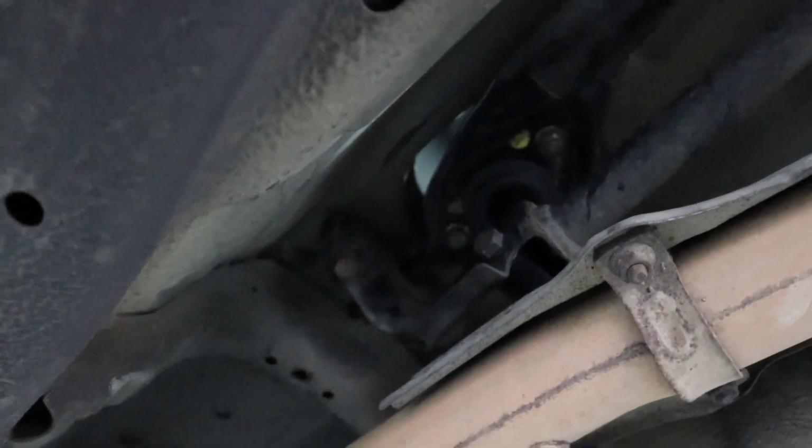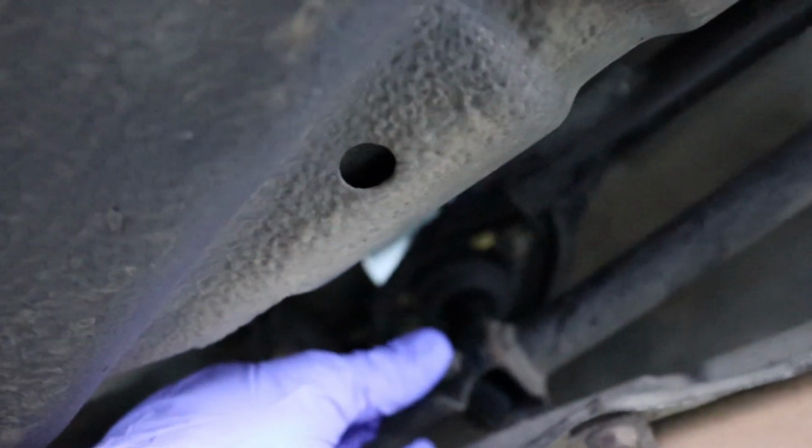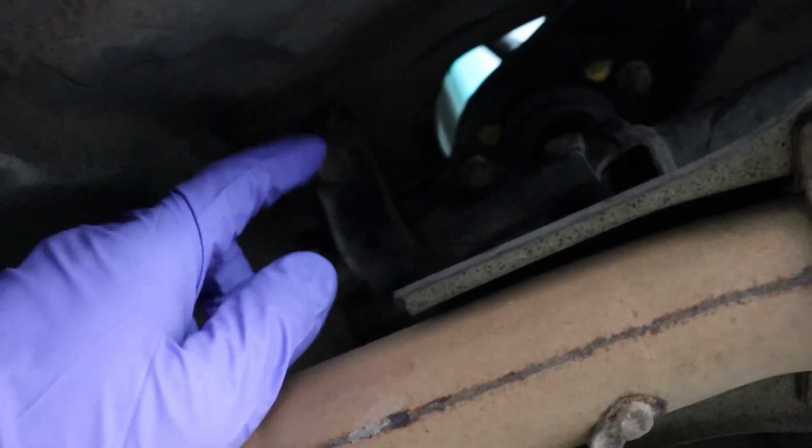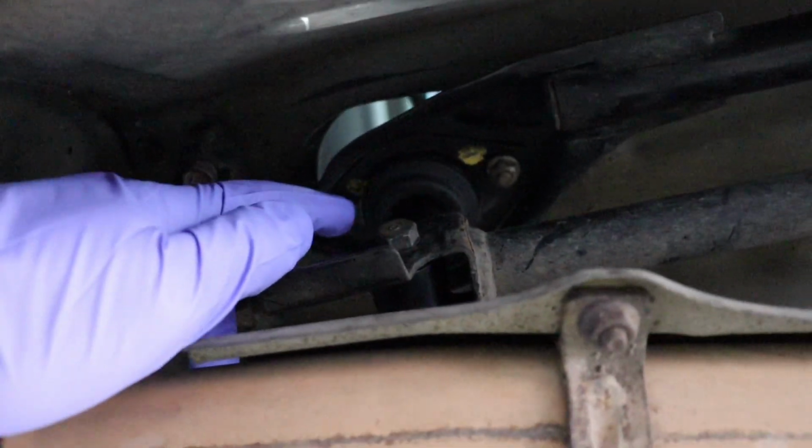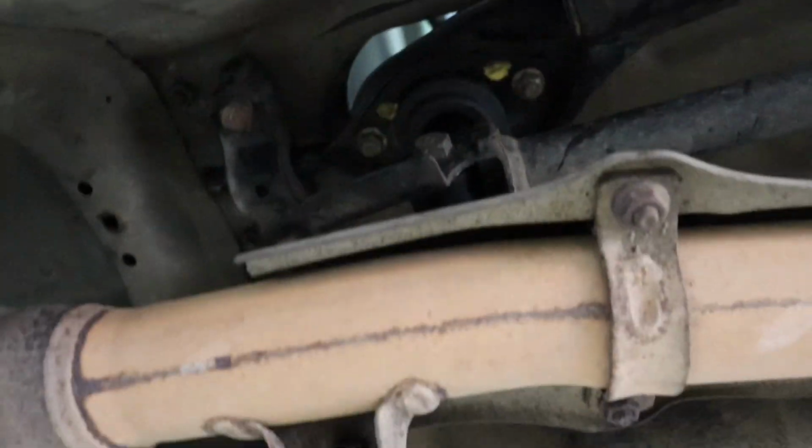Alrighty, we got the car up on the lift. Now that we're underneath, I'm going to need to remove this bolt here from the bottom of the stock shifter that connects to the linkage. You can see it, I'll focus on that right here. And then I'm going to need to get these 2, there should be 12 mil. Got to remove these 2 so we can get the whole assembly out. And then we can get to these once the whole thing's disassembled.